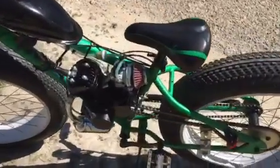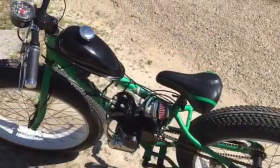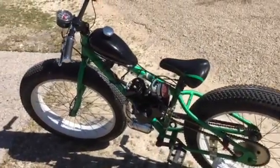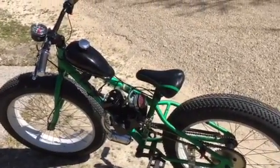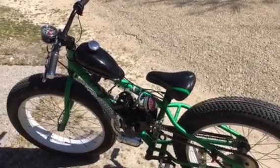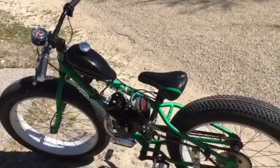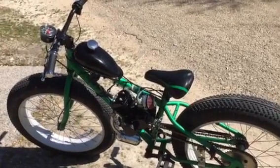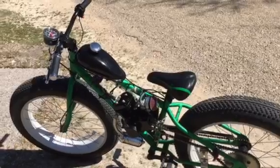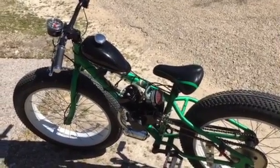As you can see in the custom carburetor right here — this is a racing carburetor. It also allows you to customize the main jets depending on your altitude. Right now I'm about 650 feet above sea level and I'm running number 65 on the jet in that carburetor, and 60 works pretty well also.